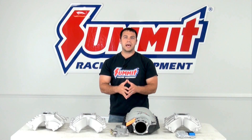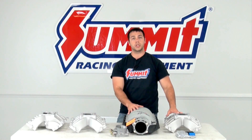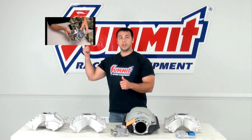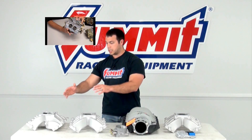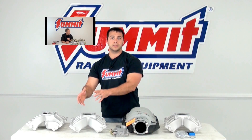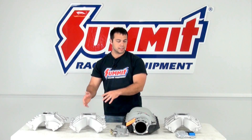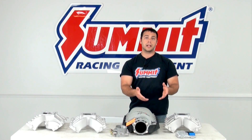Now, the big question is: which is the right setup for me? Is it a carbureted setup or is it a fuel injected setup? We've actually done a video on EFI versus carburetion in a different series — Dave did that video and you can watch that here. What it really boils down to is cost. A carbureted setup, you're going to pay for your carburetor as well as an ignition box, running about $300 for the carburetor and about $250 and up for that box, where a fuel injected setup is going to be somewhere around $1,500 and up.